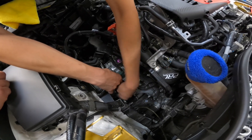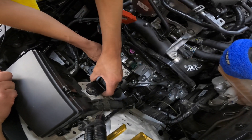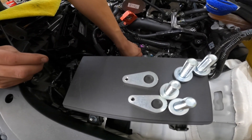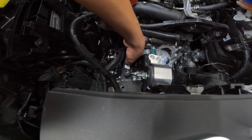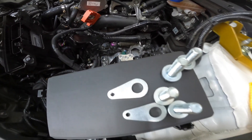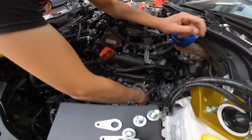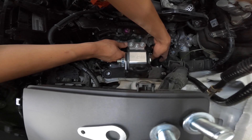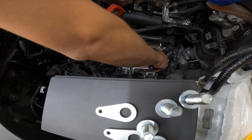We're a little bit too high on the trans with the jack, so we need to lower and adjust — none of the holes up here are aligned yet. The hardware Hasport provides includes some extra washers; you retain the OEM studs and they provide washers to replace the originals. I paid for the proper torque package this time. Once everything is in, make sure it's tightened to the proper torque spec — the last thing you need is a loose bolt flying off when you're on track.